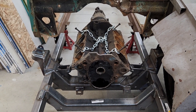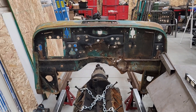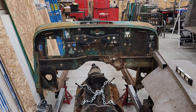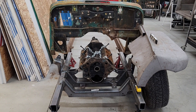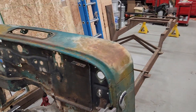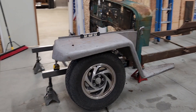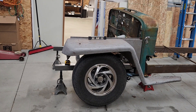The transmission is free-floating right now — I've got to build a crossmember for that. I've got my mock-up firewall on here so we can get the spacing right so our distributor clears the firewall. We may be able to move the whole front assembly back another inch or so; I'll get that figured out in the very near future. Just for fun, I did go ahead and get one front fender bolted on and set a tire in the hole where the spindle would be.